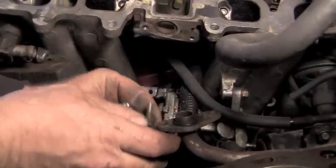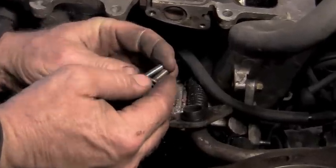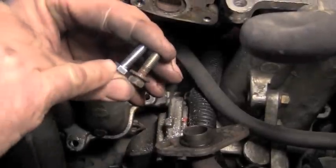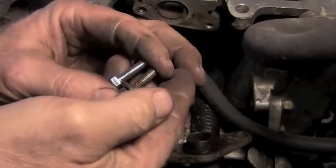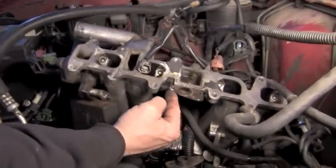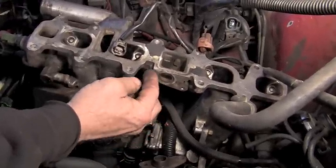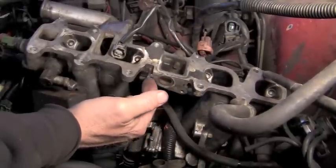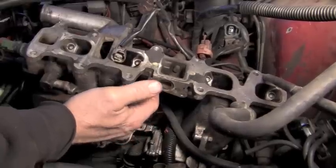So you measure up the new bolt to the old bolt, get the right size bolt, then we're going to install a washer on the new one so that it will match up with the old one and be good to go. Okay, Dwayne has previously indicated of the two holes, we have a good one over here, a stripped out one over here. So we've already drilled it and removed the bolt that was broke off up in the hole, and now we're going to drill it for the proper sizing of the Heli coil according to the specifications